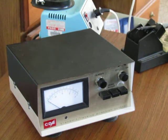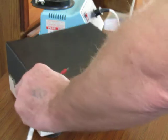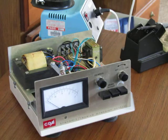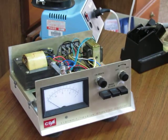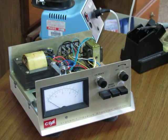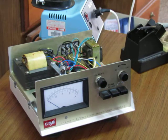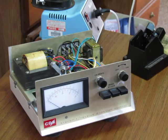This little conversion is two wires. It hooks up right across the bulb socket inside. So I'm just going to remove the lid. You can turn on the light here, you can see. And I'm going to remove the bulbs out of the socket here. Make sure the electricity is off so you don't get zapped. And I'm just going to solder this across the bulb socket.